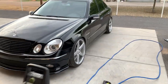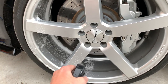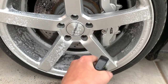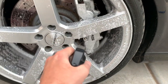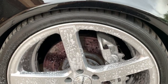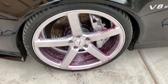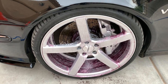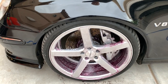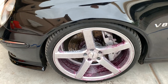I'm going to spray the wheel cleaner on the wheels — it's pretty cool if you've never used this. It has a chemical that will turn the metal particles purple. I get it on the brakes as well. You'll notice the whole wheel area turning purple — that's a good indication we're getting rid of the metal byproducts that come off the brakes. You can already see it on the rotor. I just let this dwell, which basically means put it on there and let it sit. I don't really find I need to use a brush to agitate it.